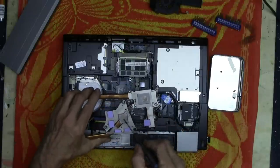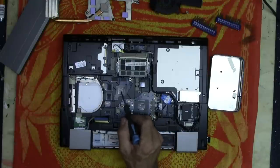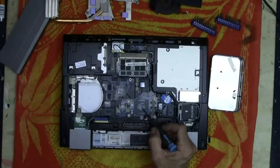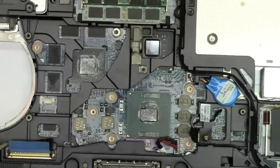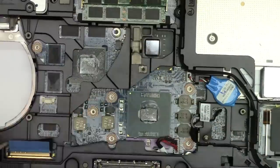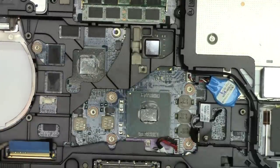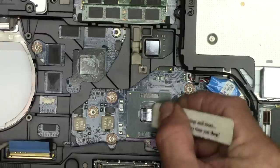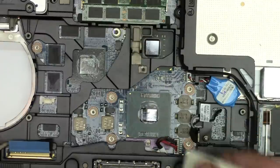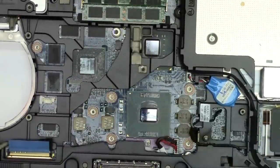The ones we're concerned with are these two right here. I'm totally guessing, but I'm guessing that that's the graphics processor unit and that this one is the central processing unit — this one has Intel on it. We've got to clean off all this old gunk first. I'm going to take an old plastic card — one of those loyalty cards from the grocery store — and use that to just scrape off the excess on the bottom of each one of the CPUs. Works quite nicely. That takes care of the bulk of it. Now we'll go with the cleaner.